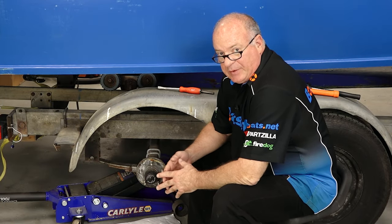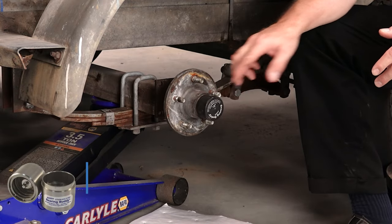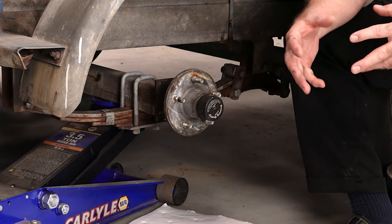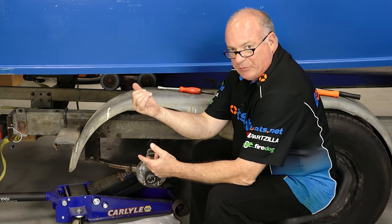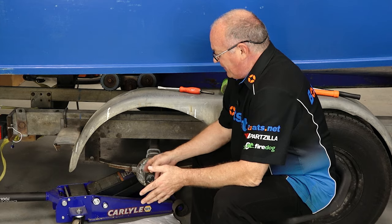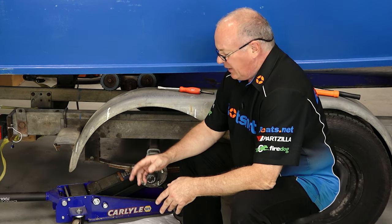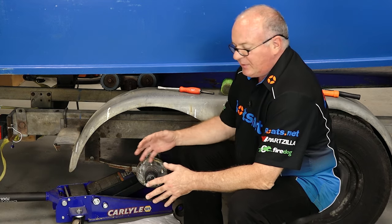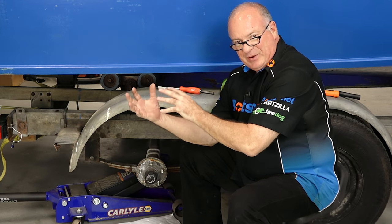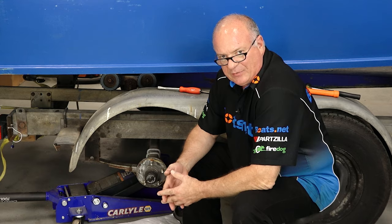More than likely your trailer has one of three different types of caps on the end of it. One is just the standard cap, the second type — like I have — is what they call a bearing buddy, and then the third one is a cap with a rubber insert that has a zerk fitting on that particular hub, and the grease flows through it to get further up into the bearing races themselves. Now if your trailer was only set up with the dust cover, the buddy bearing is a good upgrade. It increases the amount of grease in there. But the downside is it only fills from the outside, so the oldest grease is still running and getting abused on the bearings inside — and just by adding more, you're really not flushing that out. That's the reason you need to repack your bearings so often.